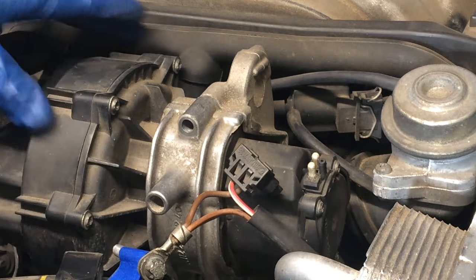There we go. So with the pump out of the way we can see two hoses: one goes here to our MAP sensor — see it going right into the back of it — and the other one has this blue on it and goes up here to the secondary air injection changeover valve. We're going to go ahead now and remove this little E8 fastener here.